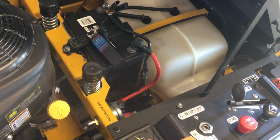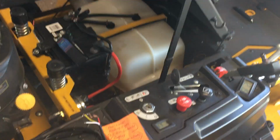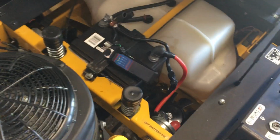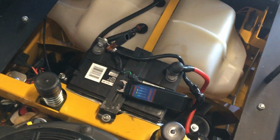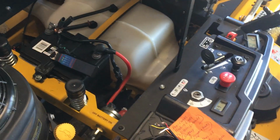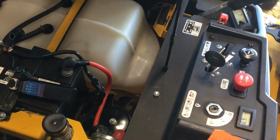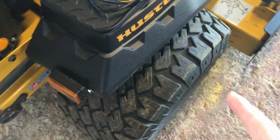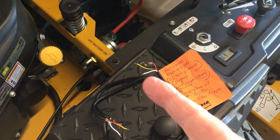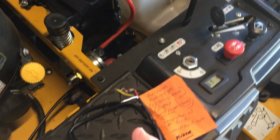Alrighty. Now, you want to know would I buy it again? Most likely, yes, but I would do some checking around. The main thing I don't like about the XDX or the XD is they don't have a reserve on them. I had to check this fall. I got to gauge my tires. I forgot about that. The only way you can check the oil in this is I got to pull the wheels off of it, get me a wrench, a 22 metric. I ain't sure what standard size it is, but it does take a 22 metric, and take that cap off. Let me show you where it's at.